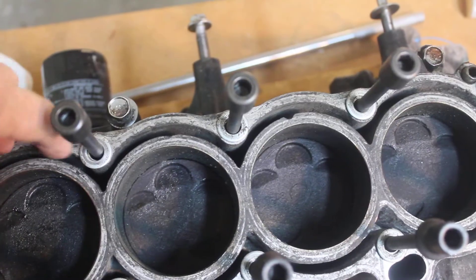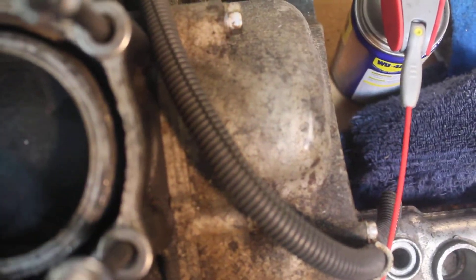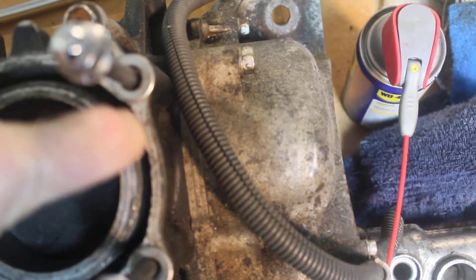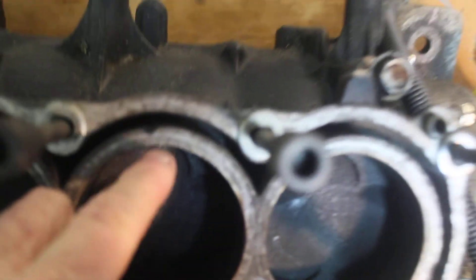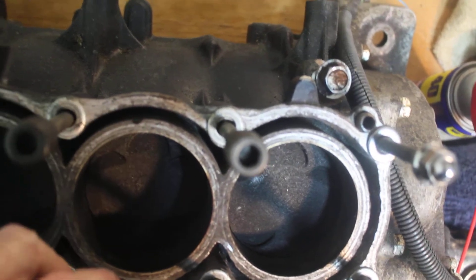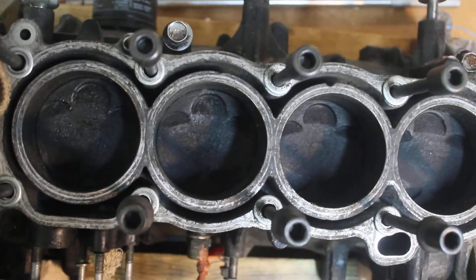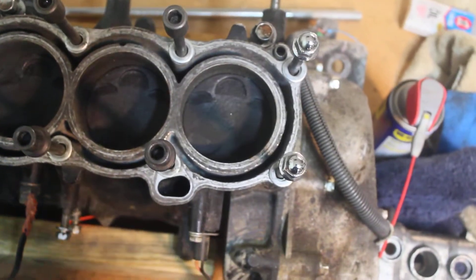Back in the water jacket there's no corrosion, but when you get up towards the front of the engine there's corrosion all on the outside wall of that cylinder. When you get over here, the corrosion is really bad — you can see there's a big pit right there, a big hole working its way through that cylinder wall. When it breaks through, that'll ruin the engine. There's some time before that happens, but it will eventually.